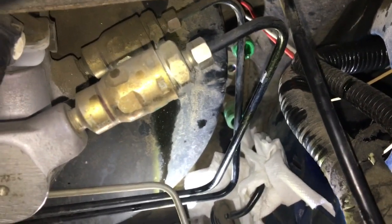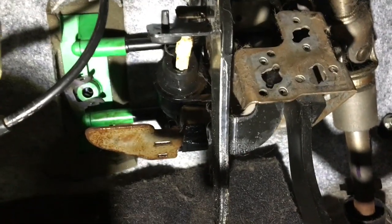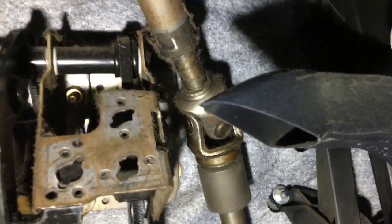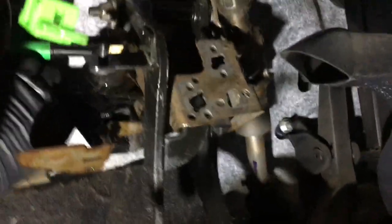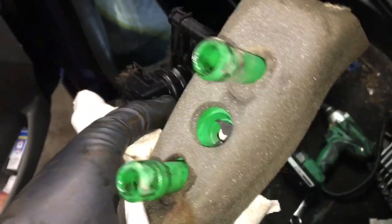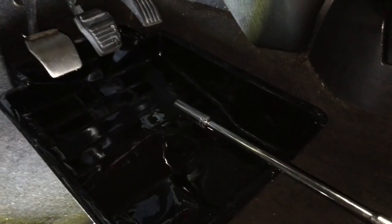Back in the cabin, the assembly is nice and loose, but the clutch and pedal assembly is preventing it from being removed. I was hoping I didn't have to, but I will loosen the four bolts holding in the pedal assembly — I don't think I'll take it off, just loosen it enough to pull that out. With the pedal assembly loose, the part has more play and with two hands I was able to get it out. Here it is — take the foam off, put it on the new one and get back to installing. Those four pedal assembly bolts are 13mm deep-wall socket.